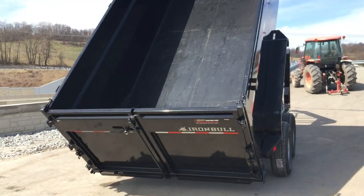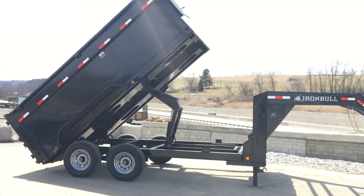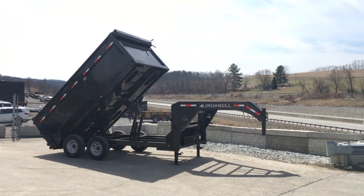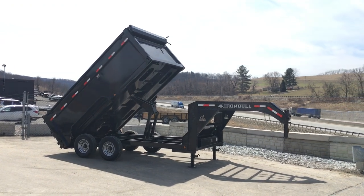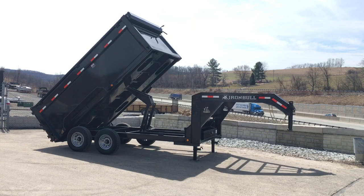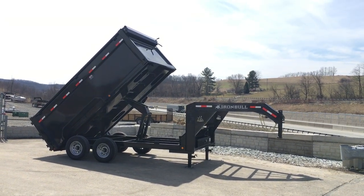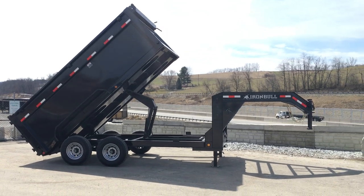Four D-rings are in the very corners — some manufacturers put them up the sidewall or in 10 inches, but these are in the very corner. A trailer like this with the gooseneck is going to net you about 9,000 pounds plus your tongue weight, so you're going to get maxed out at maybe 12,000 pounds depending on how you load it. With the high sides, we recommend this more for framing lumber, drywall debris, leaves, mulch, shingle debris — stuff with 20 to 30 pounds per cubic foot weight, not stone, sand, or concrete debris which runs 85 to 150 pounds per cubic foot. A trailer this size is going to net you somewhere right around 14 yards. You could load it up with framing lumber and mulch and fully utilize the full space. If you occasionally want to haul stone, of course you can — you're just going to get less than a full load.